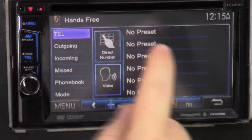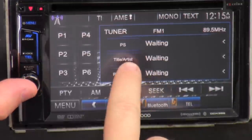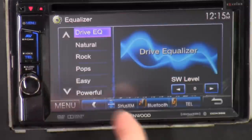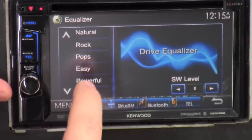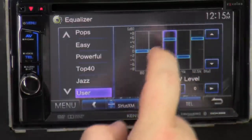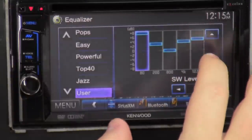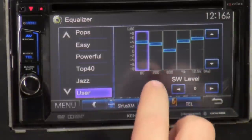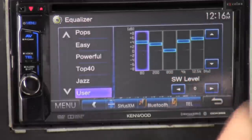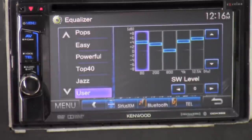Let's go to the tuner. You see right here where it says ATT on, ATT off — that's the attenuation button. Press and hold the volume button and it takes you to your equalizer settings. It does have a five-band equalizer, so you can actually adjust everything by clicking on the equalizer bars however you want. If you can't get exactly where you want, use the buttons to dial it in. The range is negative 8 to plus 8 on all bands: 80 Hz, 200 Hz, 800 Hz, and 4 kHz — that's basically bass, mids, and treble.